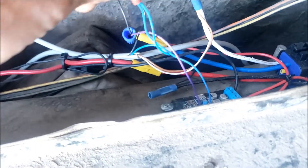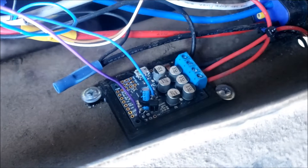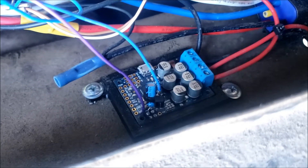The pulse width signal from the computer comes in on this blue wire and goes down to an analog input on this DC motor speed controller. We have a capacitor and resistor, and the blue wire goes back up to the Mega Squirt box. We're PWM-ing the Mega Squirt box output, which gives us a different analog value presented to the analog pin. That correlates to a duty cycle that the Mega Squirt commands based on fuel pressure — if fuel pressure is low, the PID loop increases the duty cycle.